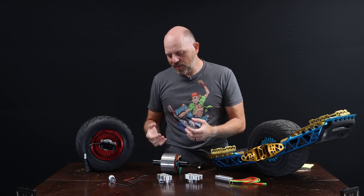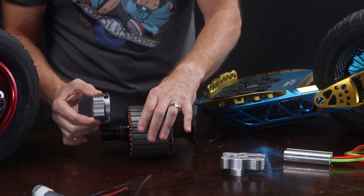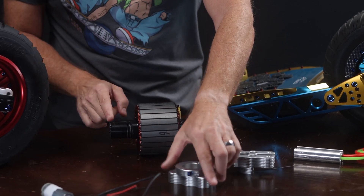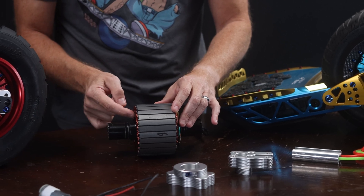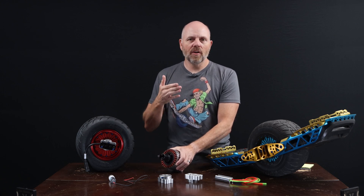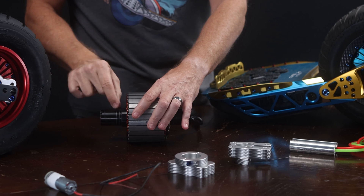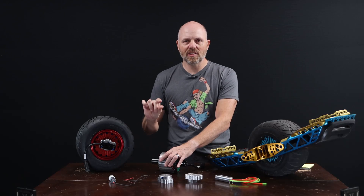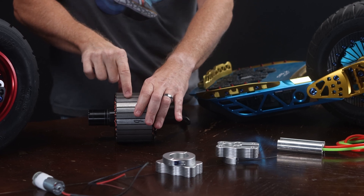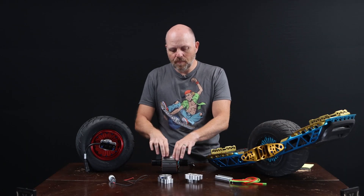There is a major bottleneck in the system. That bottleneck is the wall thickness of the axle right at the point where the axle carrier sits. Aluminum flows heat well from the windings to the axle carrier, but you still have this thin wall thickness that can only flow so much heat — in the same way that a hose can only flow a certain amount of fluid. At the bearing juncture, a rubber O-ring sits in a machined groove that narrows the axle even thinner, creating an extreme bottleneck. On top of that, you have distance — heat really can't flow well from the stator into the axle and into the carrier.